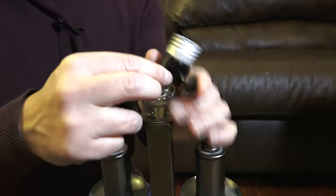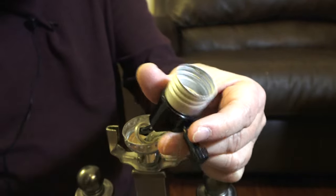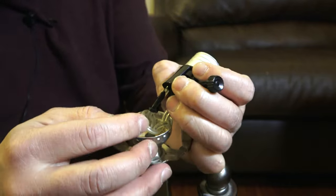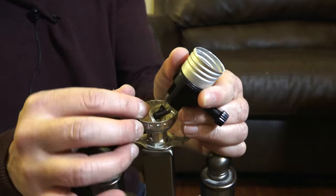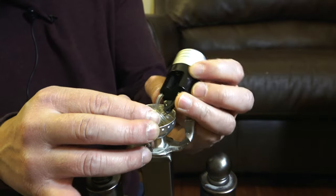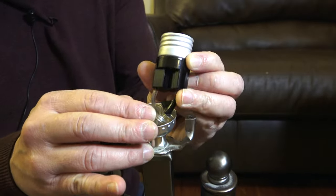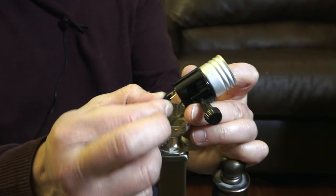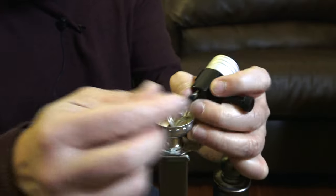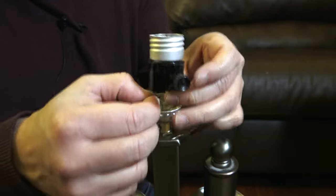I also want to point out that the wire coming off the ground here is knotted. If your new replacement fits, you want to unscrew this and undo the wire, but you also have to redo the knot. This way, if you tug on the wire, you won't pull these wires out of the socket — that's why the knot is there, to prevent that from happening.